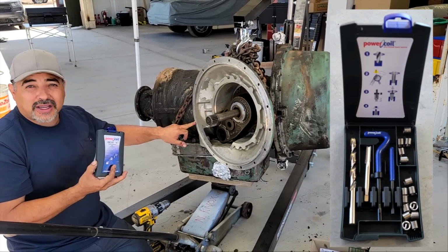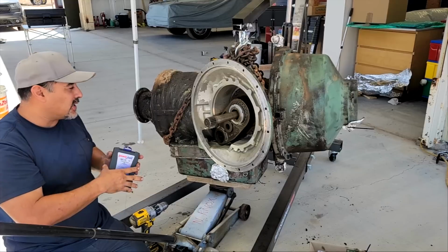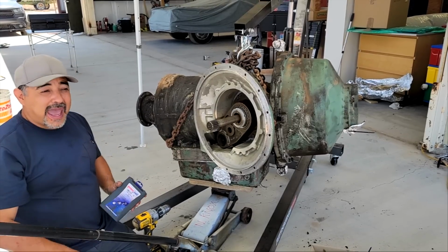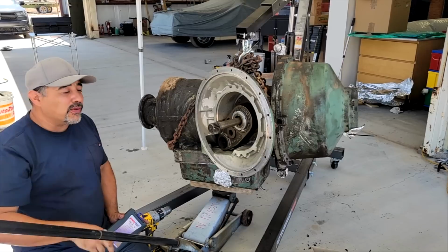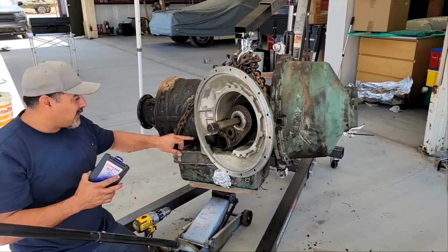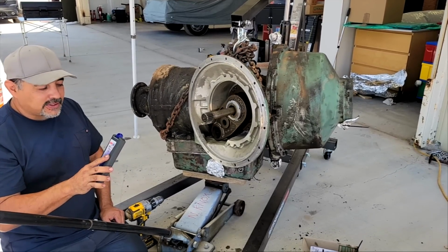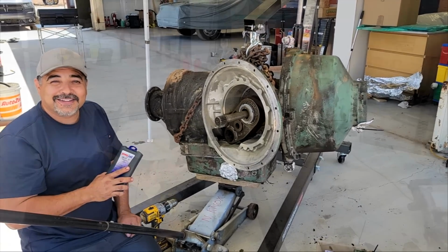We've had to buy some bolts because I think what happened here is this bolt was not long enough, so it only grabbed a few of the threads, and it was too much, and they let go. A couple of these, and this one specifically, when I went to undo them in the back, were extremely loose. I could literally hand remove them. That's probably why. It wasn't deep enough, and it just barely caught a few of the threads and ripped those out. So we're going to repair that today with this. Hopefully this will be pretty easy, and then we'll get ready to put this guy back in.